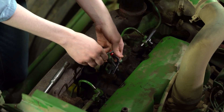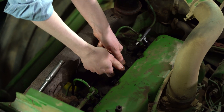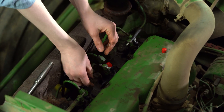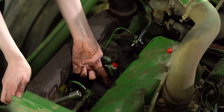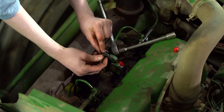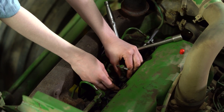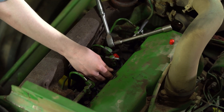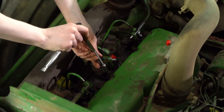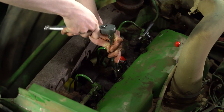I'm going to take the cap off the bottom of my injector and then drop it right down into the hole. This is going to go a little bit hard, but it will slide down in there. I'm going to move this fuel line out of the way and slide that over into place. The spacer is going to go underneath here. I'm going to set that right in there in place. Then I have this bolt that goes in here. Notice that there's three spacers on top of there and then this little washer — this all has to line up. This goes around the injector and then drops into the hole. I'm going to tighten it up, and the next step will be to connect all the fuel rail system.